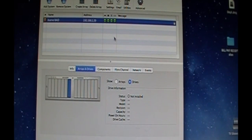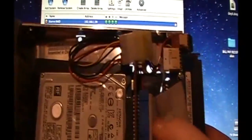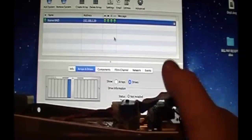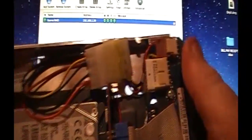So I'm back. Check this out. So this is an updated layout. Now, the StarTech, very small, you'll see I have a little cable bend here. But it still fits. It fits fine. This is with the ADM cover off. What I did was I kind of twisted it a little bit to shove this on the side so I could put one screw in right here. Okay. Now, I did use some snips, and I cut the extra 4-pin Molex off of this so I didn't have all these cables. This wraps around perfectly. It's in there secure. It ain't going anywhere.